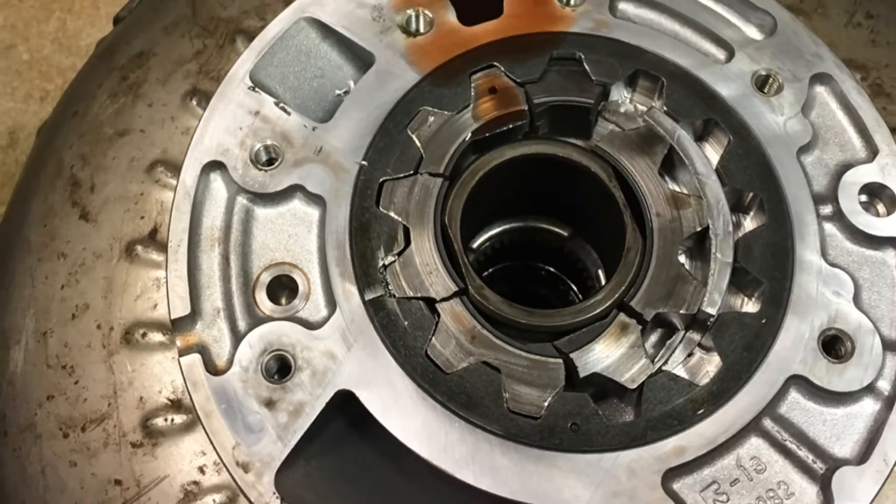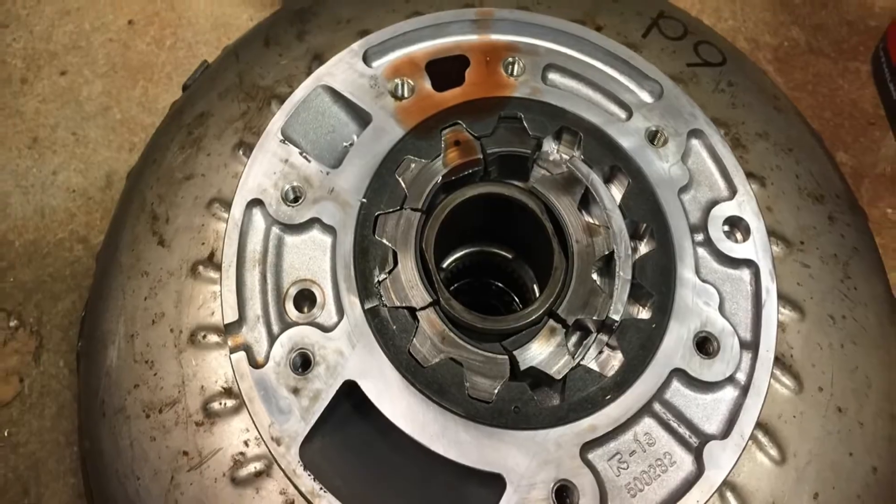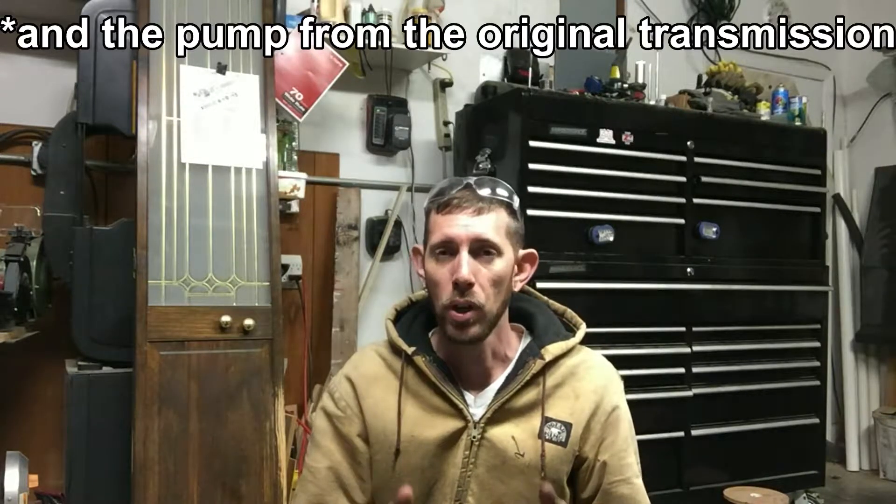The seller told me the rear cover was damaged and chipping - he'd pulled the rear cover off and the clutch plates out to check for damage, and everything looked good, so he put it all back together. I asked if he had accidentally left the washer out; he said he probably just forgot it. Turns out I found little pieces in the pump, which caused the pump to break into about six or seven pieces. I found more pieces in the filter and a couple more in the valve body. I got all that cleaned out and used the new-style wave washer from my original transmission.